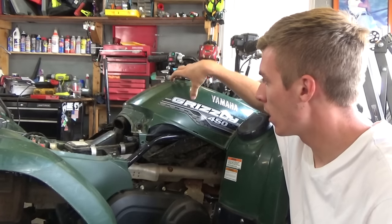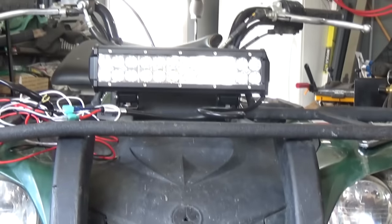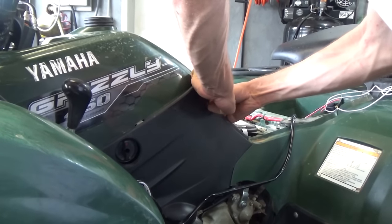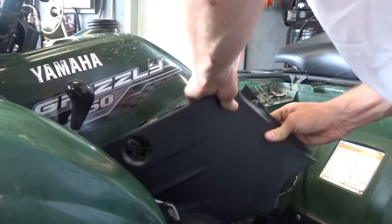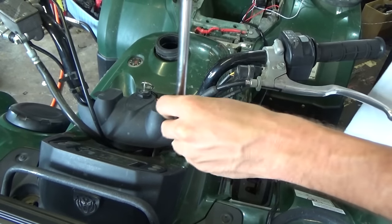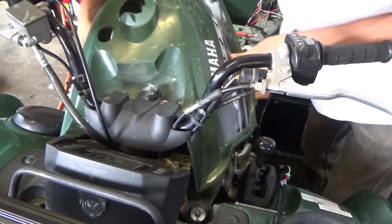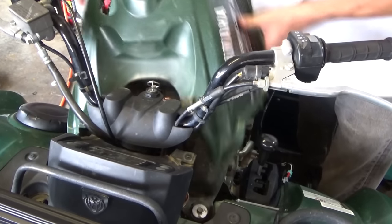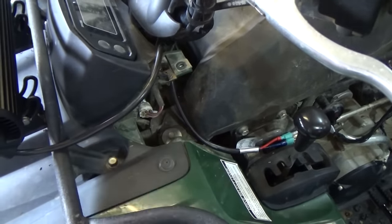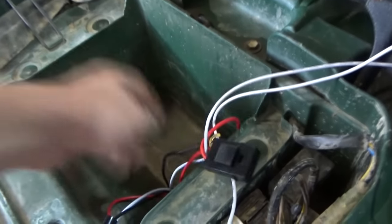The way I have this light bar, I'm going to go ahead and take off the plastic that covers the gas tank so that I can run the wire out of sight back to my battery and finish hooking everything up. I'm going to run the wire back here so I don't have to drill any holes in the plastics. Once I get it below the plastic, I'll run it tight to the frame with some zip ties, get it to the battery, and find a spot for my fuse and my relay.